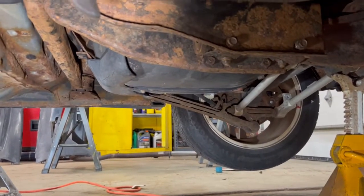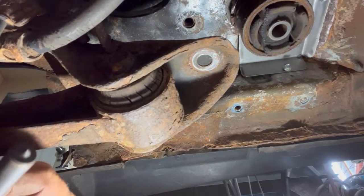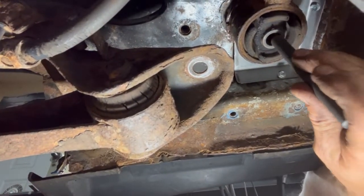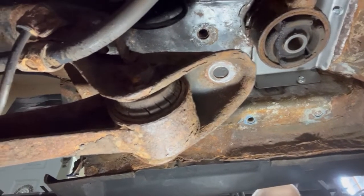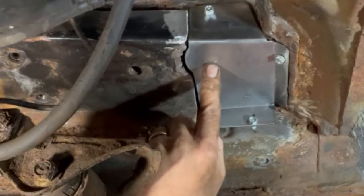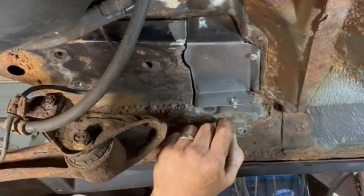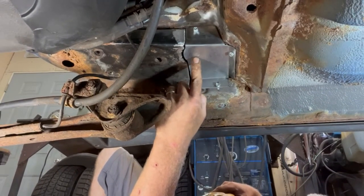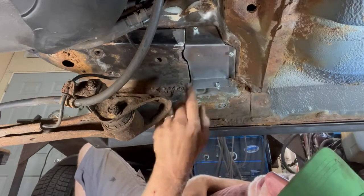Got the t-bar in place on the passenger side — put the main body bolt in and the plate on just to make sure all the holes line up. Now that the t-bar is up in place, I'm going to take a transfer pin — just a pin with a point on the end — put it up through the hole and nail it a couple times with a hammer. That gives me a nice transfer point. I'll take all this apart, drill the holes, and weld it together. These sheet metal screws are really important — they locate the panel and hold the flanges tight while I weld them. It's definitely hard to hold this up and weld at the same time, so the screws make it so much easier.